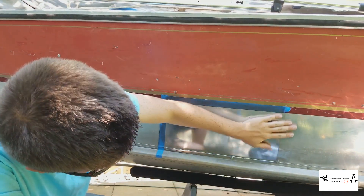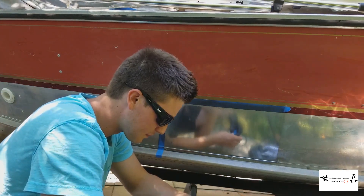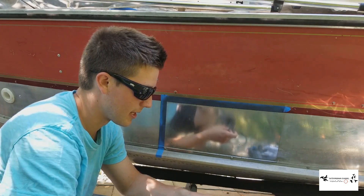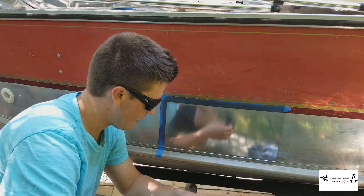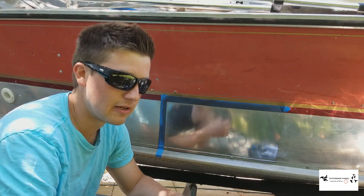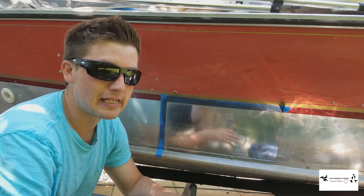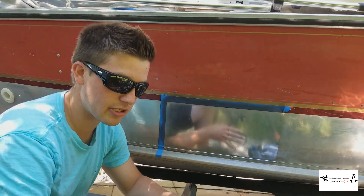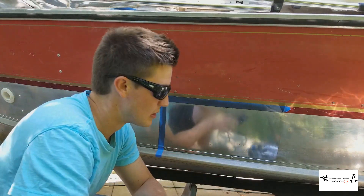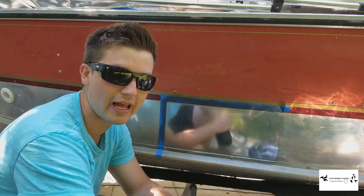You can definitely see a pretty distinct line here — the polished side had watermarks and everything and the polish took those out really easily. It looks good, don't get me wrong, it looks really good with the polisher, but it's not as good as I was expecting. My previous video using just a rag by hand looked almost just as good. If I were doing the whole boat again, I'd probably use more of a high-speed side buffer — a single action — because the dual action is designed for cars and I don't think it has enough power here. Or honestly, if you just want results, using your hand with a rag is pretty effective.